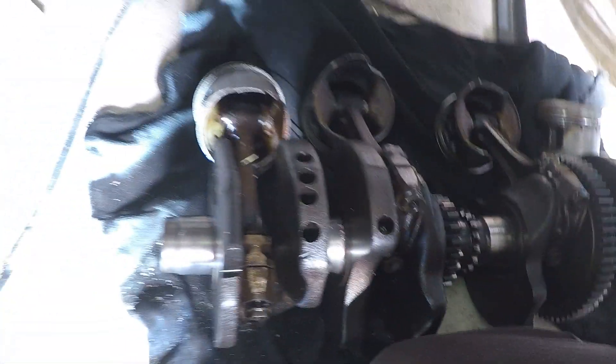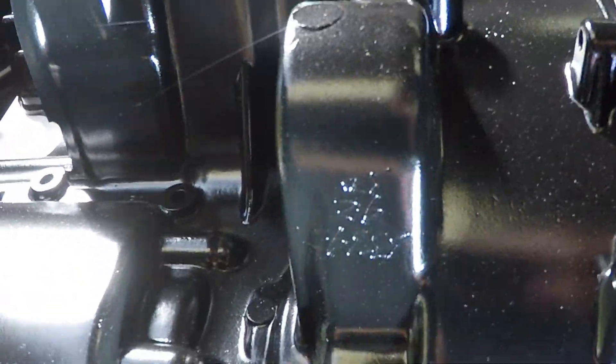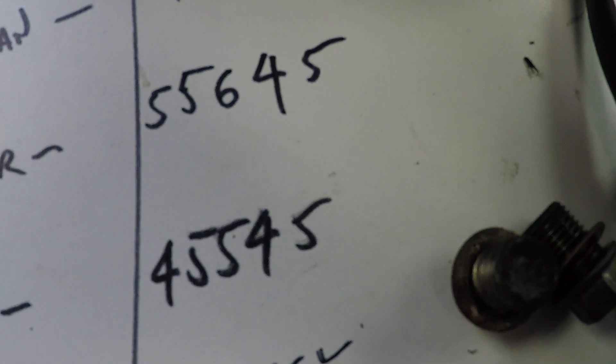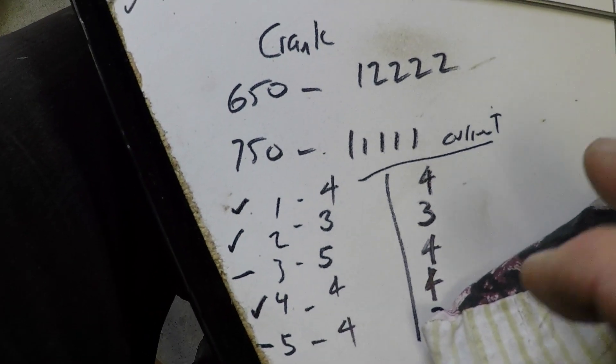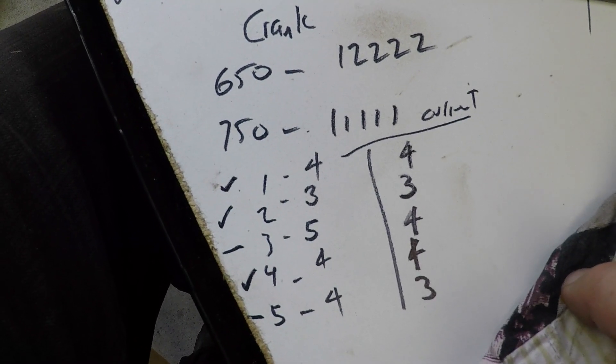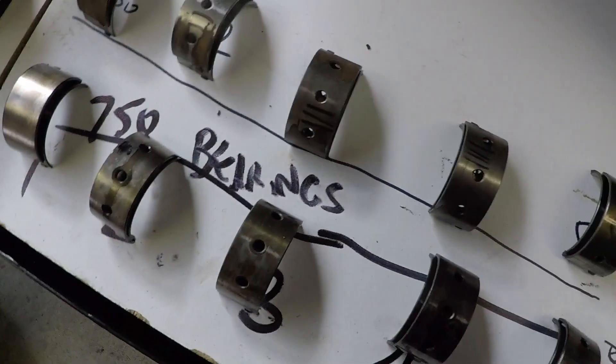On the engine casing you'll find some numbers scribbled where the alternator is, just here, and the five at the bottom are upside down but they're actually relating to the size of the journals inside that casing. Yamaha have an equation to use and they come up with different coloured bearings, though I don't really know what sizes they represent.